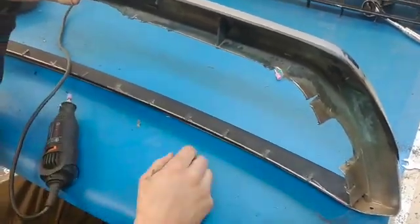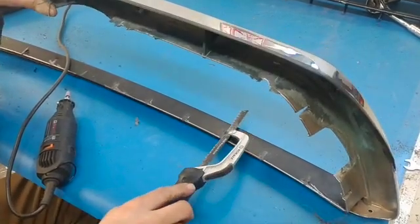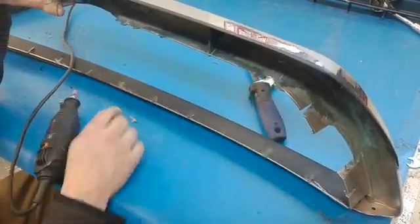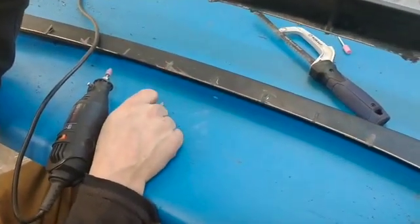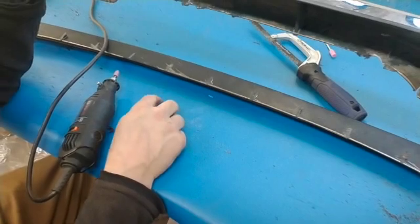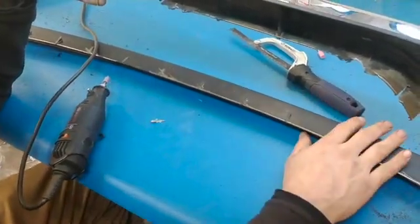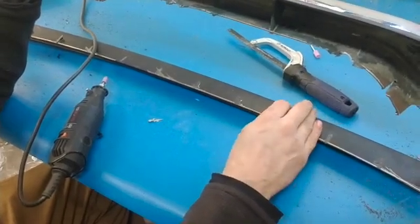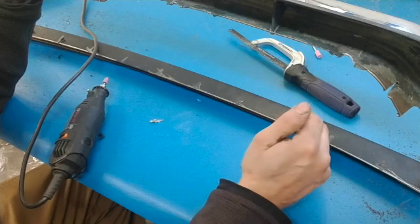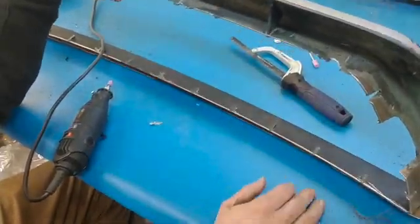All right, so what we're going to need next is our Dremel tool of some sort, a rotary tool. We can also accomplish this with sandpaper. We can take this saw and get it as close as possible. When you do that, you might start scratching some things, which is what I did with this one. Again, this is all going to be hidden. You can come back with some flat spray paint and paint inside here and it'll look just fine. The grill itself is obviously going to hide a lot of this, so we can just make it to where we want it.